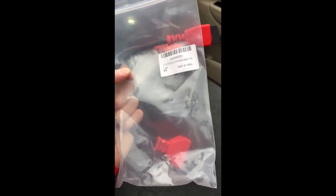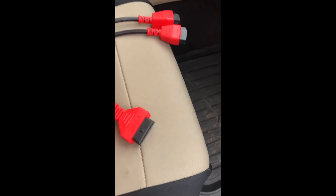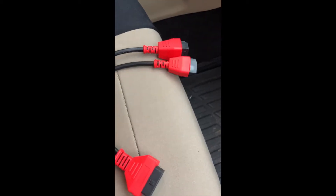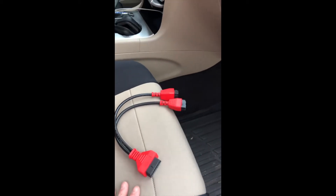I'm going to show you where to hook up this Chrysler 12 plus 8 universal adapter cable. This is needed on some newer vehicles as a security bypass if you want to use your V-Peak or any other sort of computer to adjust the settings in the ECU, the car's computer.